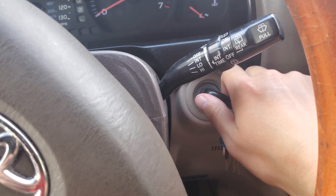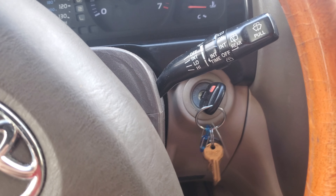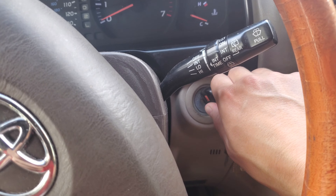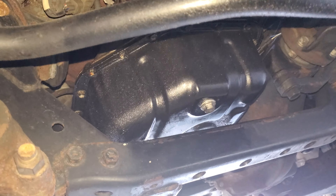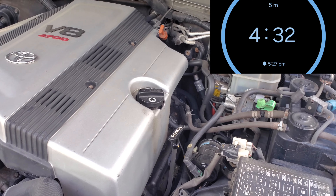The way to do this is run the vehicle for a few minutes, get it up to operating temperature on the gauge, then shut it off for a few minutes. It's very important to wait a few minutes after shutting it off before checking it. You need to give a chance for that oil to seep back down into the pan so you get a proper level, because that oil is being pumped all through the engine through little tubes, and it needs a chance to sink back down via gravity to get back down to that pan.